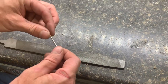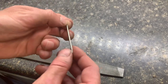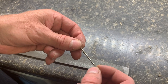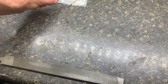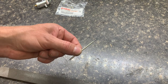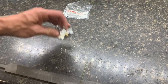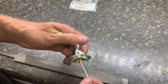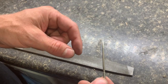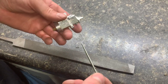There are actually a couple of Mikuni needles on the market that come in YZ125s and a lot of Mikuni needles that have a stepped round tip — perfectly round, but they make the needle much smaller at the end so that the needle doesn't play a role at wide open throttle. This is really important. Now, if you're running really low needle clip positions, like if the needle is at the first or second clip from the top, you might have to extend how high up you go with this so that at wide open throttle it's not restricting fuel flow. Do not make the needle shorter — you need the length of the needle to stay the same so that it doesn't pop out of your needle jet at wide open throttle, which would cause a hanging throttle issue.